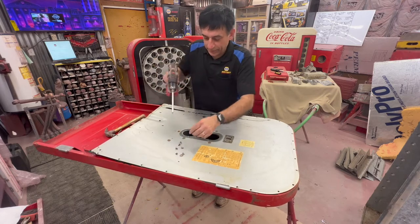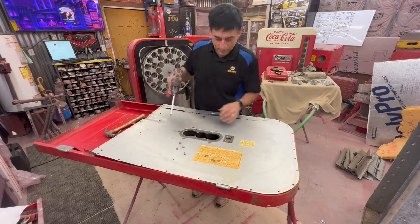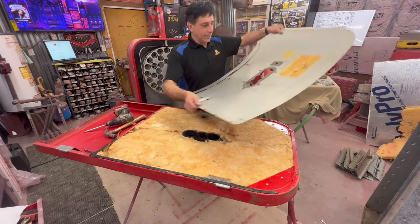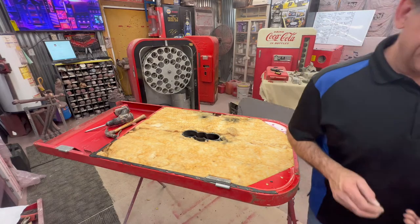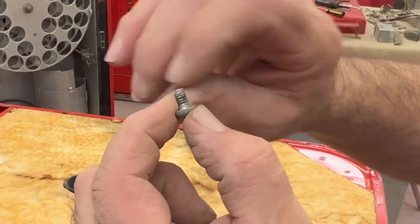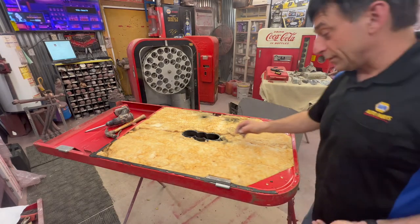I just did a Vendo 39 four or five months ago — I should remember this. These are critical screws; they go into plastic. The screws for the plastic liner have a little cut-away that helps cut into the plastic. So when you're trying to figure out which ones go into what hole — if you see a cut-away like that, those are the ones that go into the plastic. Sometimes I'll stick those right back in there.